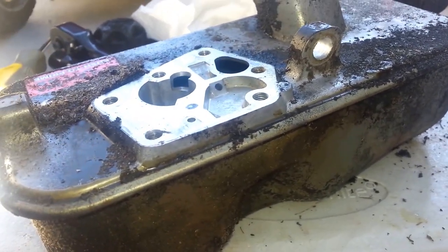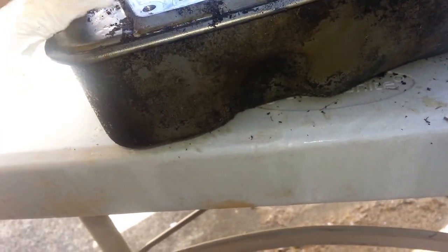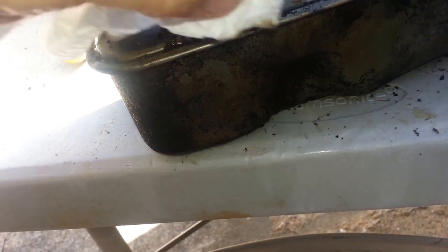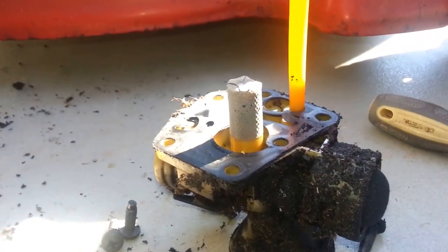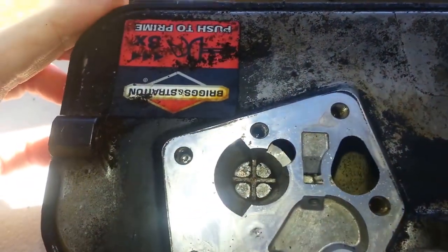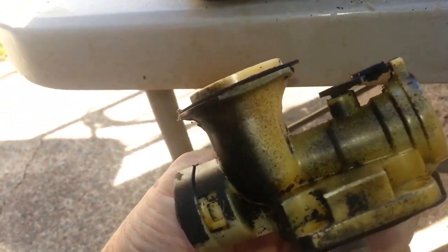Now I'm ready to put this back together. Make sure we do some cleanup — make sure all the surfaces are nice and clean. With as much junk as I've got on this thing, we want a good seal back in between that diaphragm and the gas tank. Get out any kind of junk that we can. That doesn't look too bad. I'm going to do the same to the diaphragm. It's a wonder what a paper towel and a screwdriver can do — this guy looks totally different, you can actually see it a little bit now.